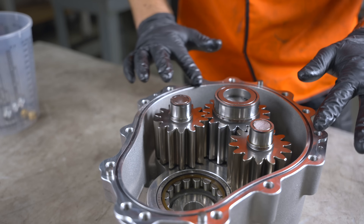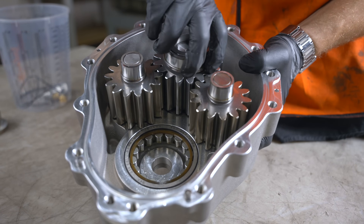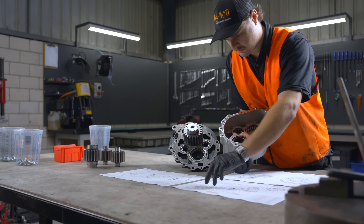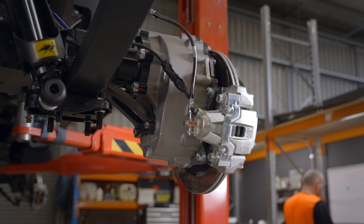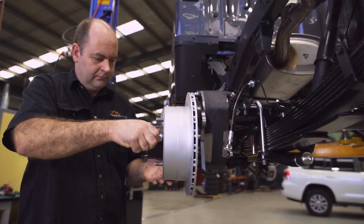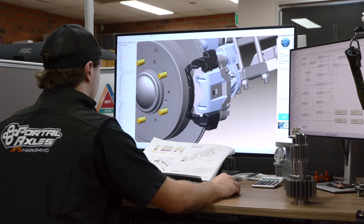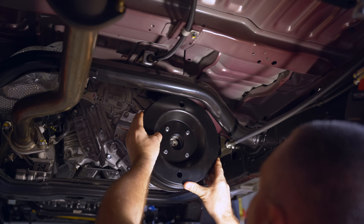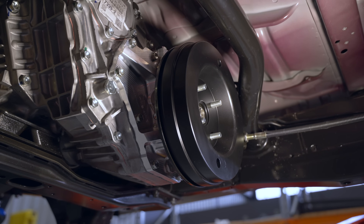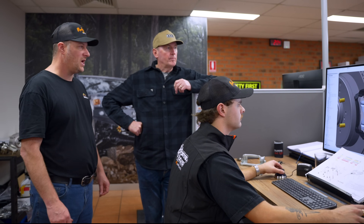Bigger gears? We've increased the width of the gears by about 10mm. We've increased the pitch size, the gear teeth roll better. We've also increased the housing size and increased the oil capacity to around a litre. Whereas before they were about 400ml. This image you're seeing here has the EPB — the electric park brake. Your car's got the transmission handbrake, so we've got two options for customers moving forward. We've had both the transmission handbrake and the EPB fully tested at approximately 4.5 tonnes.